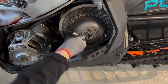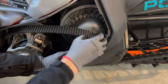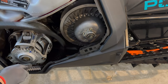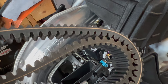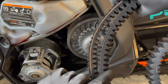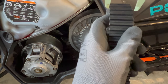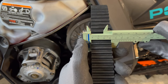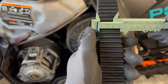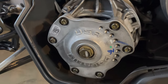You can see the belt has dropped down in the secondary clutch. Here's the used belt — I'm going to compare it to the new belt. The fiber on the new belt is still brand new. I measured multiple spots on both the new belt and the old belt with 500 miles on it, and for the most part they're right on 35 millimeters. So no change in overall width over 500 miles.